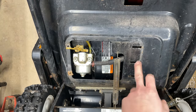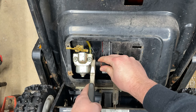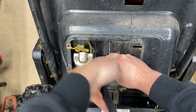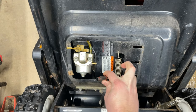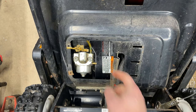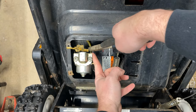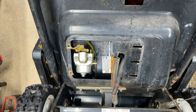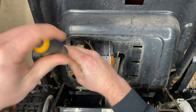It's a good idea to make sure you don't have a lot of gas in the gas tank. Now this fuel line is above the gas tank, so it shouldn't leak any fuel except for maybe what's in the bowl. Let's just tuck that down here for now, out of the way. Then the fuel primer line from the primer bulb — just disconnect that. These two screws, I should say bolts, hold the carburetor on.